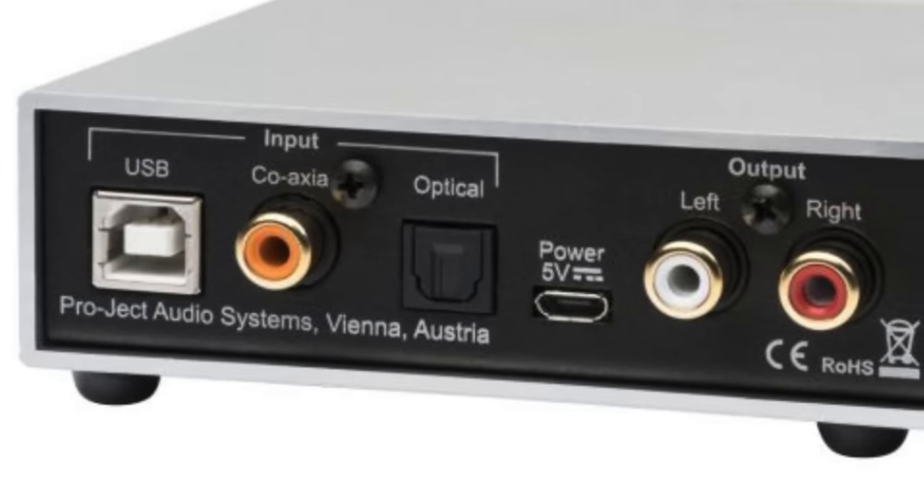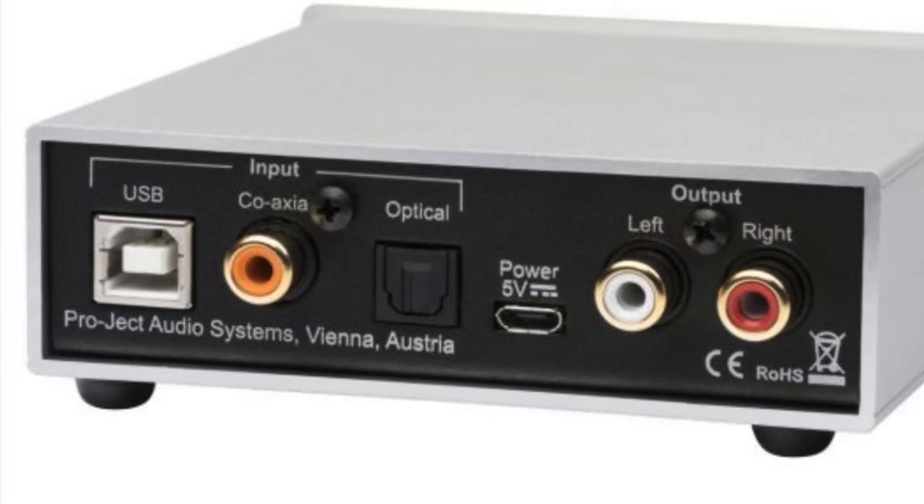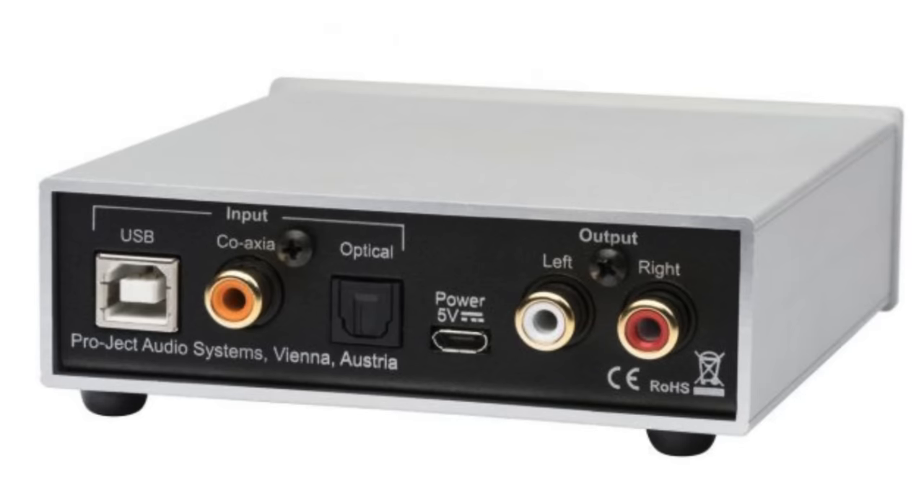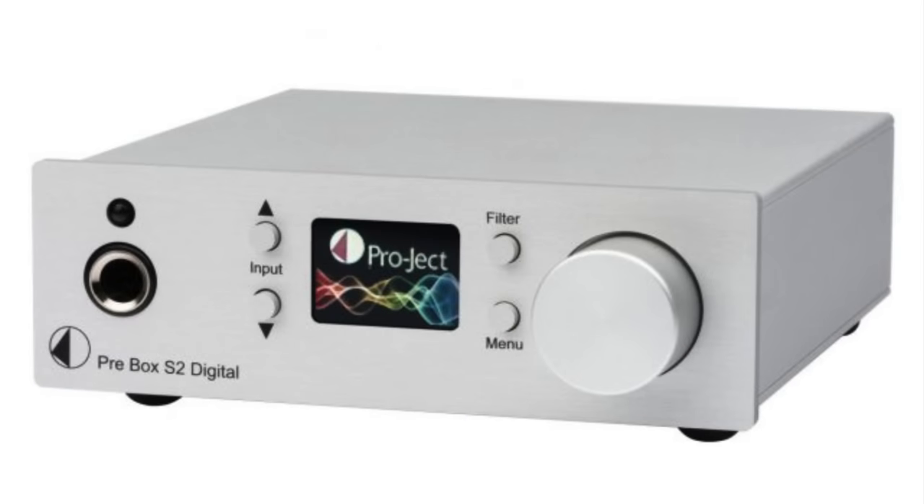This one's got line output on the left, two connectors to connect up to other items in that mini system, and it's got an optical digital output — which is why I chose this particular machine over others I could see for sale. With that optical digital output, you could connect this up to an external DAC, a digital to analogue converter, which potentially would be better than the built-in one inside the machine and make those compact discs sound even better. Whether or not I'd be able to tell the difference, I doubt it very much.